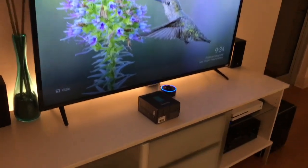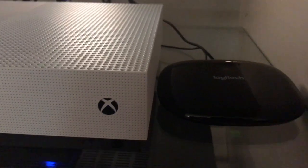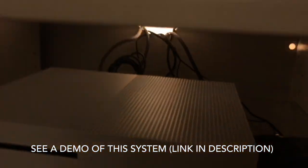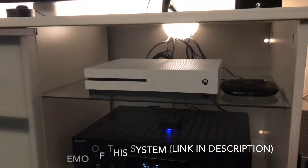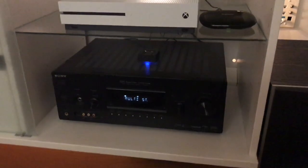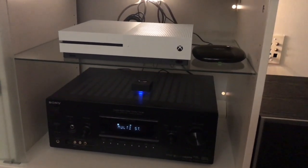It's really not that complicated. First of all, you just want to get one of these Harmony Hubs — I got mine on eBay for about $50. Here's the Harmony Hub: it just needs power and it also has an IR emitter right there that sends a signal to the television. Pretty much anywhere you place it, it will be able to send the signals — it apparently bounces them off whatever it can. In this setup it's able to hit the Xbox and the receiver even though it's above and behind it a little bit.